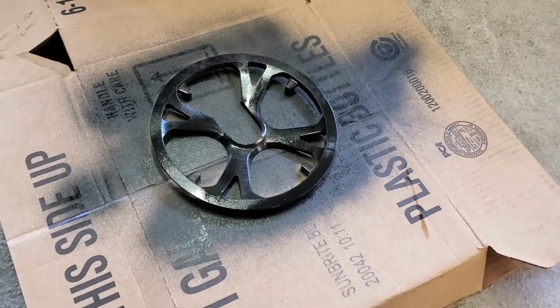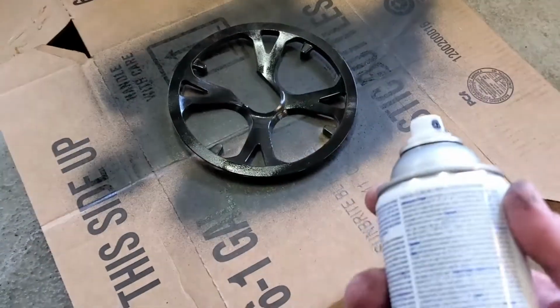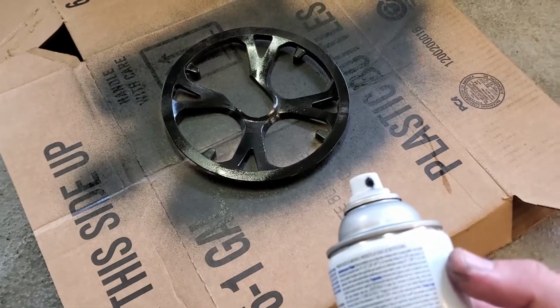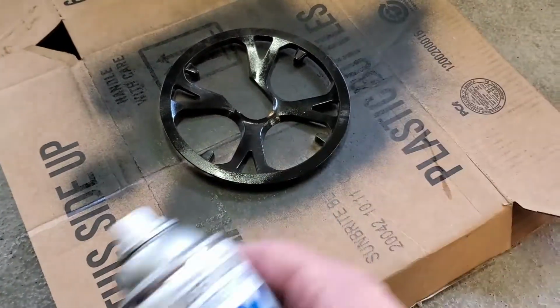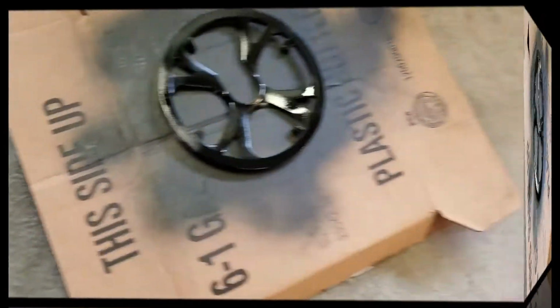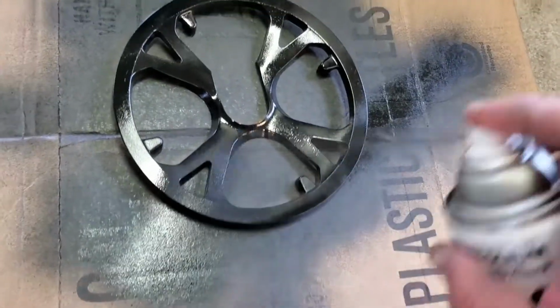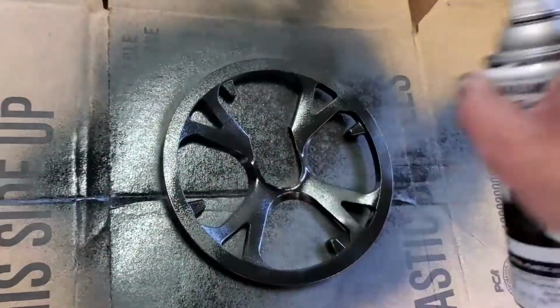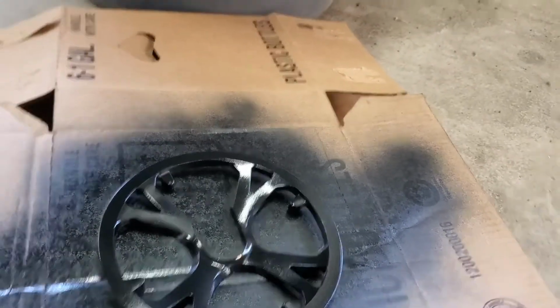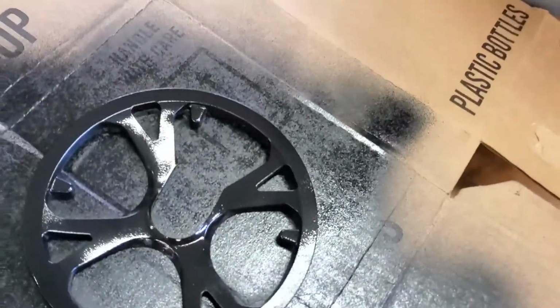You have to let it dry. The first layer has to be a very light coat. Let it dry for 2-3 minutes. Then again and again, add more coats. Alright, 3 minutes of drying, let's apply a second coat. Nice and even. And let this one dry.